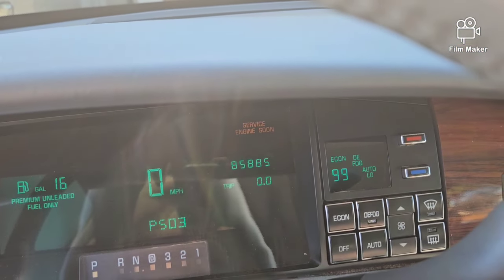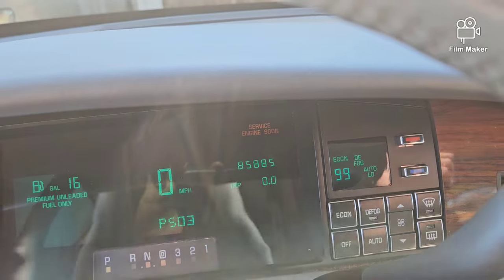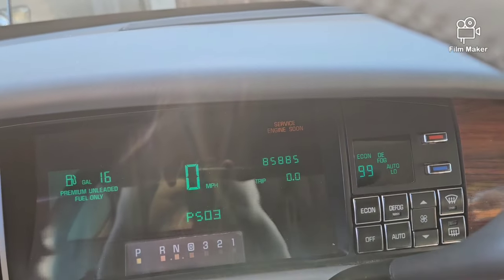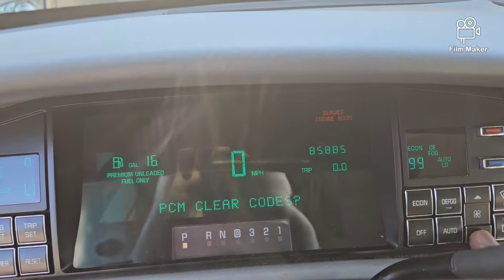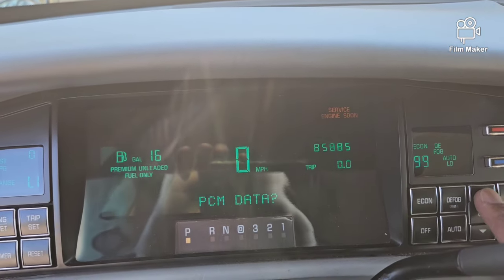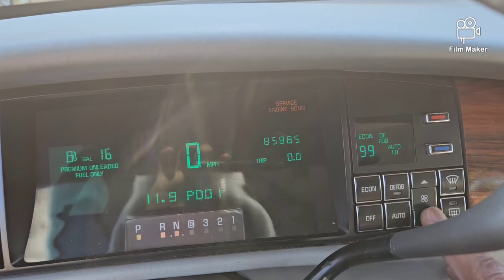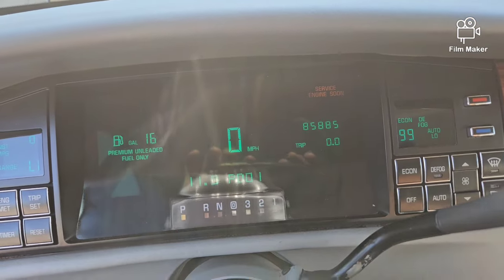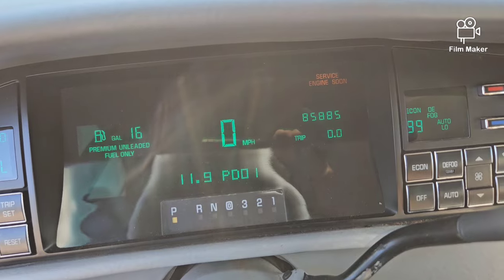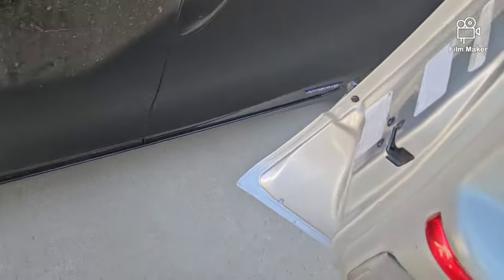Sorry about the sun hitting the camera. So you can see where it says 58 right here. To extend that speed motor out, you're going to hit Warmer and then see it goes to 99 — at that point it should extend it out, which I did hear. Then what we're going to do next is push Off, go down to Data, push up on the fan speed, and see this here — 11.9. So this is how you get your reading. For it to be safe it needs to be at 13.4.